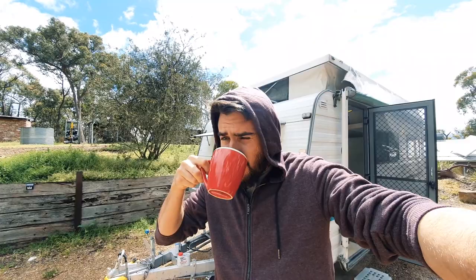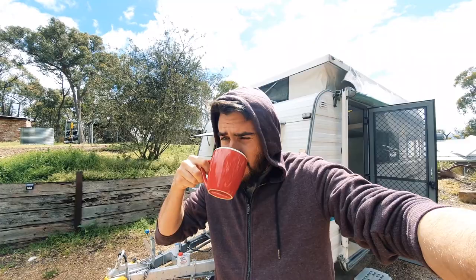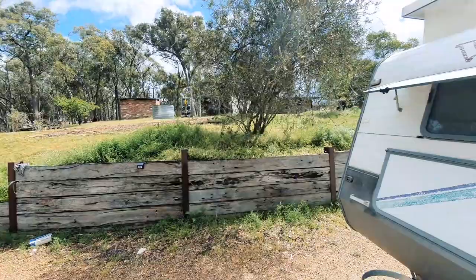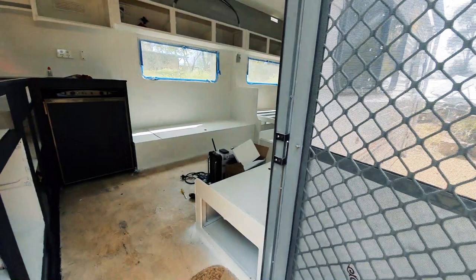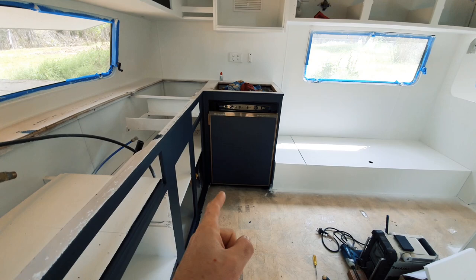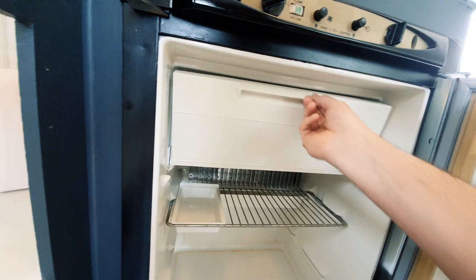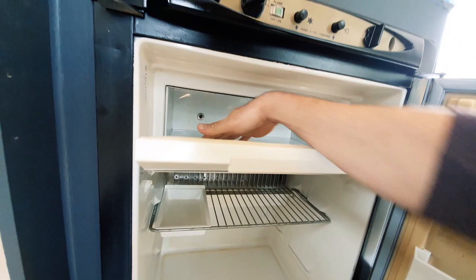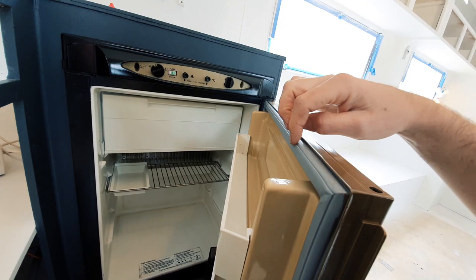It's not the best day for spraying - it's beautiful now but it's gonna be one of those days with belts of rain and sun. Anyway, finished the fridge last night and just put the door back on this morning - it's actually running right now, about 15 minutes in. I can definitely feel the back fins cooling down, I can actually hear the gas moving around or something. The freezer plate's getting down now, so that's cool, that's working. The seal with the heat across this lip ended up making a good connection with the back plate, so that should be completely sealed - just the freezer part won't be.